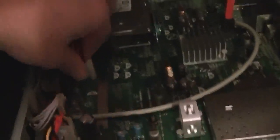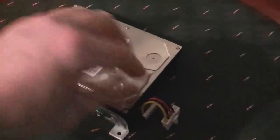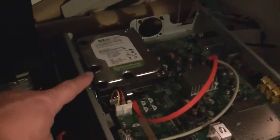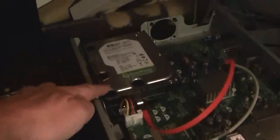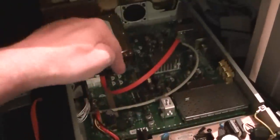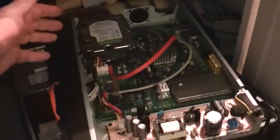We can also unplug the power to this. I just had one screw in there holding it in place so it wouldn't move around. Now that two terabyte hard drive is wiped and ready to be used. We're going to hook this drive up to the machine. Our second drive is hooked up — you can see the power cable and the SATA cable running to the board for the DirecTV machine, hooked up just as it would have been from the factory.